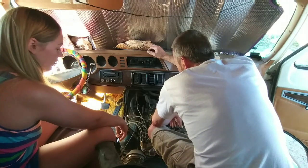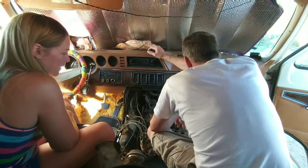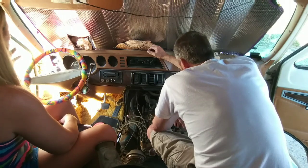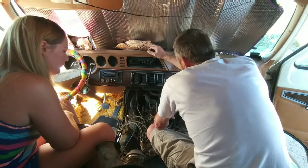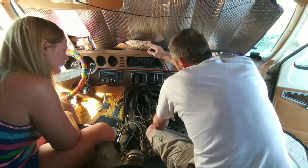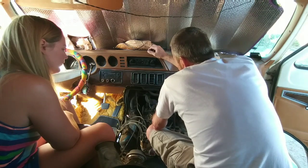And then the vacuum leak. And we had a huge vacuum leak right here, and that did help. It actually did help. It runs better now than it did. But we still got a real lean condition going on, and I'm just not sure what it is. Could possibly be that when the guy built this carburetor, he didn't get the float set right. He didn't get it set right the first time because he had to take it back off and take it apart and reset the float. And the kit comes with a little gauge that helps you set that float.